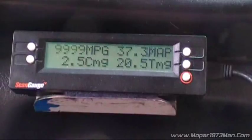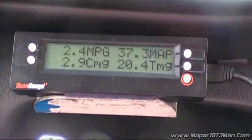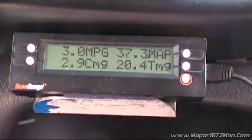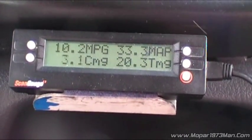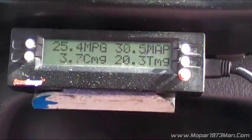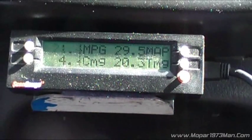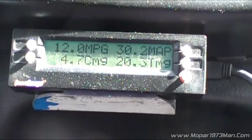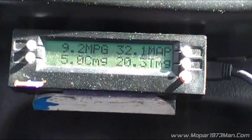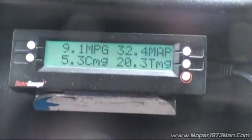20 pounds of boost. I'm going to shut the window so we can hear. But as you can see there's a very big skew — like I'm cruising right now at about 3 pounds of boost and I'm showing 32 on the gauge, so I know that number is totally erroneous.